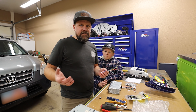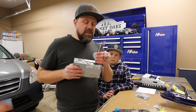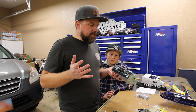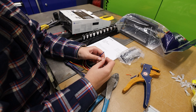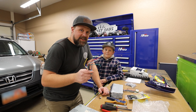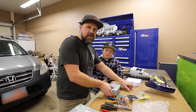This car doesn't have a power antenna or an amplifier so that wire won't be used. Also, this radio does not have the ability to hook up to the orange wire, so it can't dim the radio lights. Any wire you don't use - whether on the car side or radio side - it's super important that you cap those off so nothing in the back of the radio is going to touch and short out. There are a couple different methods for connecting the wires: you can use white crimp caps, you can solder them, or you can use butt connectors.